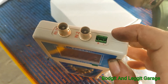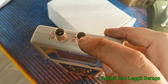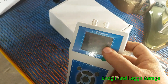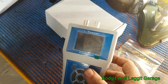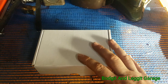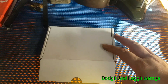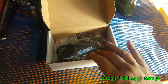At the top we've got a dual-purpose input which we use for our relative compression and for the connection to the battery. Then we have a measurement or sync input — this is where we do the syncing for our relative compression. Then we have a sync and voltage measurement input, because this is also a voltmeter as well as a compression tester. There are more options going to be added very soon. I'll leave all the contact details and where you can buy this from down in the description — depending where you are in the world you go to different places, so just contact them and tell them I sent you.